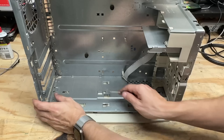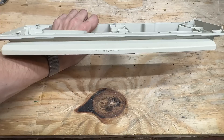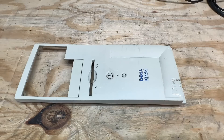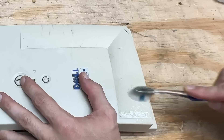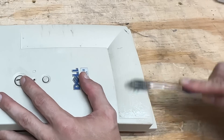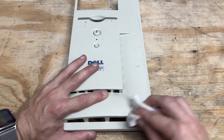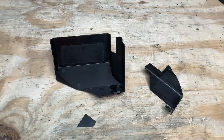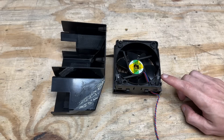Let's clean up that case — the bottom panel just slides off. Soapy water has gotten us this far; let's try the magic eraser on the trouble spots. Magic indeed. Now it's the faceplate's turn — let's get that perished sticker off. IPA is great for removing sticker residue; WD-40 works great too but tends to leave a film. You do have to be careful with IPA around badges. That CPU fan duct is made of the most brittle plastic known to man — it literally just crumbled in my hand while I was de-dusting it. I'm going to have to glue it and JB Weld it and hope for the best. Also glued and reinforced the tabs on the fan. I've got to get a 3D printer.